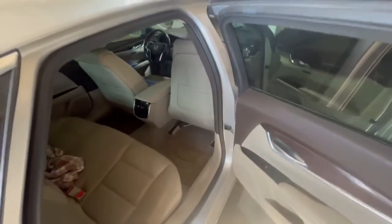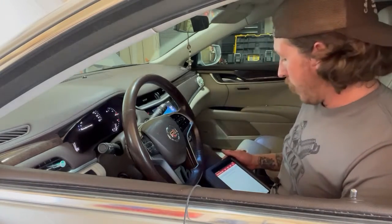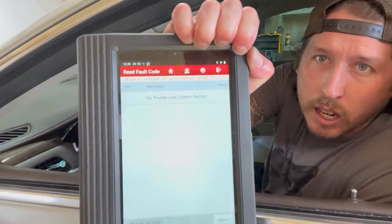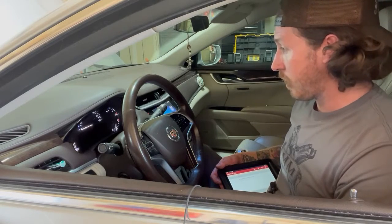Check all your seam lines all the way around and up top — just take a minute to make sure everything looks flush and good. It's the wrong color seatbelt, I know, but beggars can't be choosers — it took me like a month to get that one. Make sure everything's tightened down. I went into the inflatable restraint module — I know I call it the SRS module but manufacturers have different names for it. Cleared out the history codes for the passenger side seatbelt, in key-on engine-off position, rescanned for codes — no trouble codes. That tells me the computer is happy with the seatbelt that we put in.